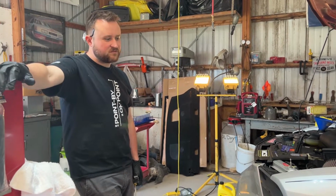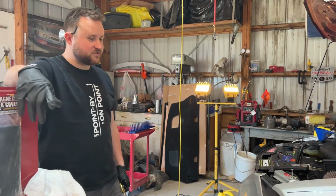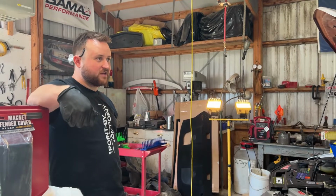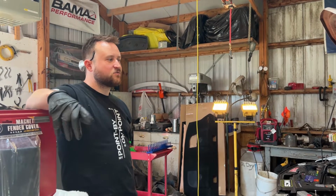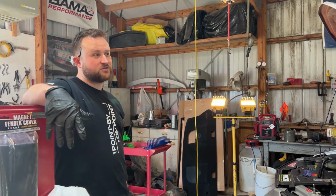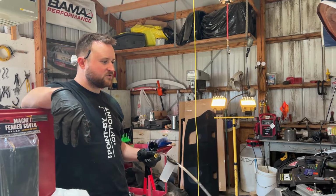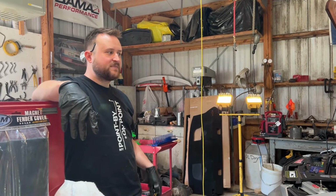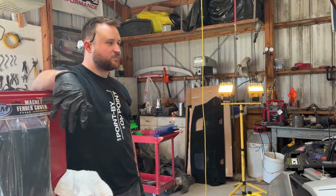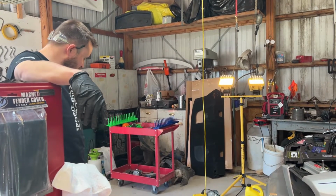Yeah. They may have been overheated, I guess. I don't really know much about brake fluid or brake pads. I know I bought Hawk HP Plus pads, and we put them on my base 2006 Corvette. Loved it. Not great for the street, way too much noise, but great bite. They held up well on the track. I didn't push the car very hard, but I think they'll be really good for autocross because they have a really good bite. They don't need to heat up, which in autocross you don't get a lot of time on the track, so there's not a lot of time to build temperature. So that's good. And then we went with Hawk HP600.